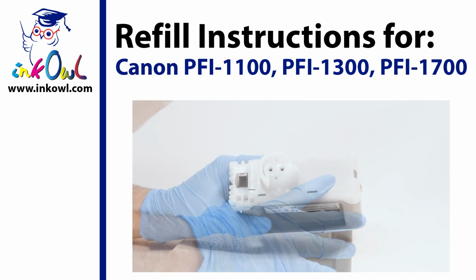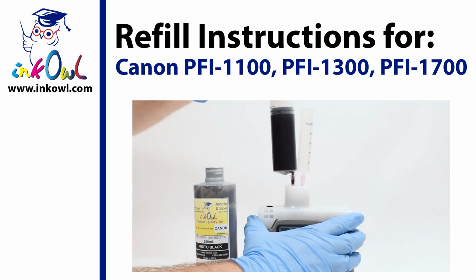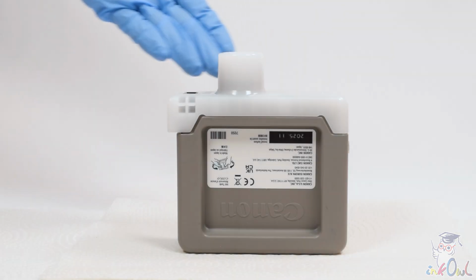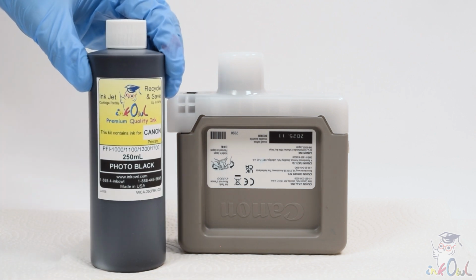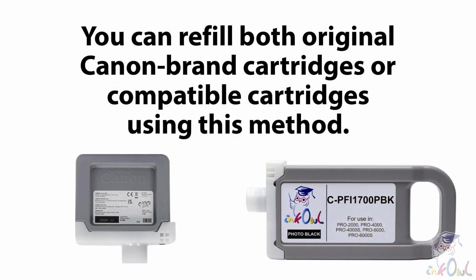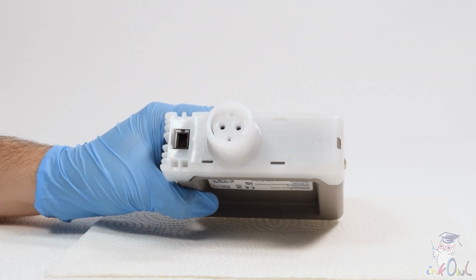This is how to refill Canon PFI-1100, 1300, and 1700 ink cartridges as used in Canon Pro Series large format printers. We'll be demonstrating the refilling of a PFI-1100 Photo Black cartridge with Inkowl's American-made pigment ink. You can refill both original brand cartridges or compatible cartridges using this method. We will be filling the cartridge through the exit ports on the bottom.